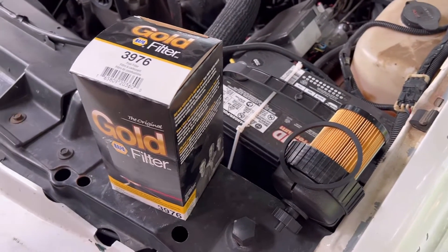I'll give it an extra quarter turn. Now with this being a DS4 truck, I don't need to bleed it. I can turn the key on and it should fire and do all the diesel things. If it was a 91-92 truck, you would have to crank it up until you get oil pressure, then crack that bleeder here on the top — this is threaded. All you do is spin it up. There's your bleeder screw. Your old fuel filter fits nice in the box, and the boxes are wax and tape coated so they seal themselves. Get your tool out of here.